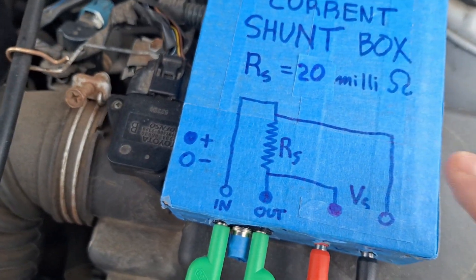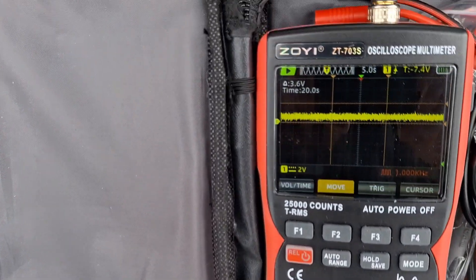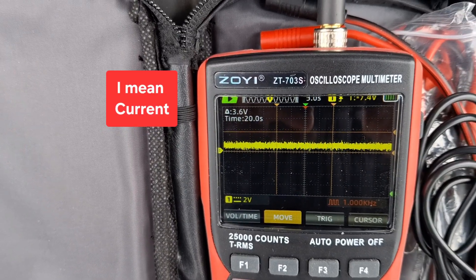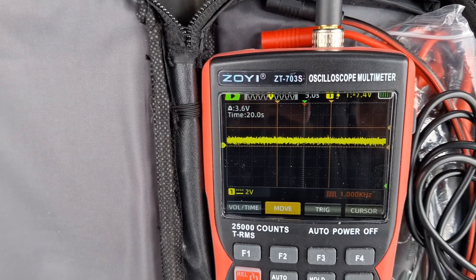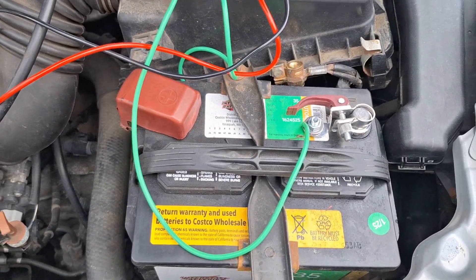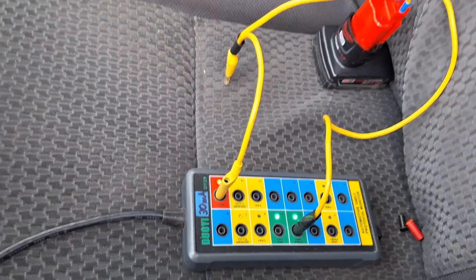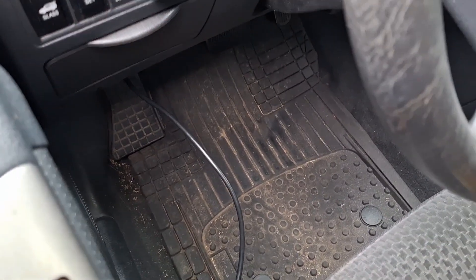I have the scope set up here and it's currently monitoring the voltage on the vehicle. The breakout box uses about 30 milliamps. I plugged the memory saver in first before doing this hookup, so right now I have the battery connected and also my memory saver, which is just a breakout box powered off an M12 battery and connected to the DLC.